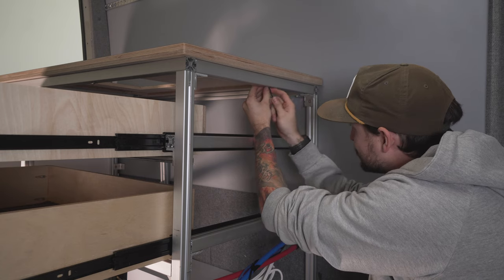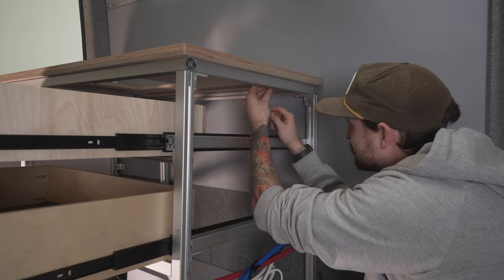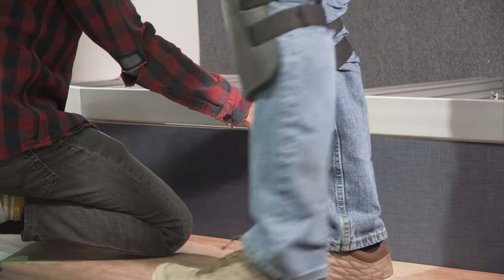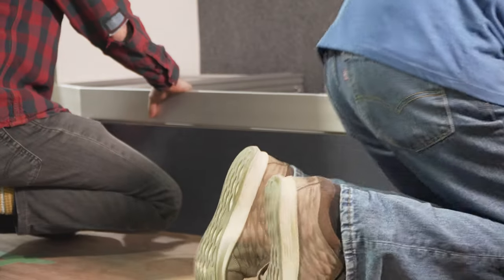That covers the entire galley, the skirting on the bed frame, and the sides of the wardrobe unit. So far I really like the clean install — it looks really nice. You don't see any of the 8020 once it's been put up, and it seems super strong. One thing I might do is use some Loctite on these panels. Right now I haven't done any Loctite anywhere, so I'll probably back out a lot of the fasteners, put a bit of Loctite in, and put them back afterwards. But that's essentially how I'm fastening everything to the 8020 skeleton, which leaves me with no fasteners on the outside and a really clean install. Hopefully that answers your question. If you like this video, hit that subscribe button and we'll see you in the next one.